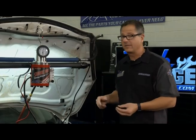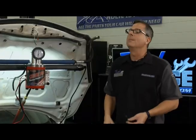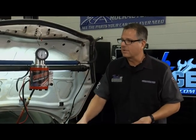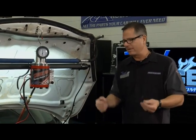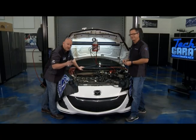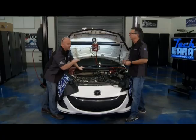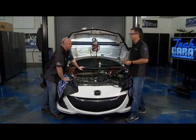That oxygen sensor is down there going, hey, we're lean — we're super lean. You know what the computer does? It compensates. Injectors go rich. So the driver doesn't even know it. He's driving down the road, everything's great. But gas mileage? Not good. I'll bet that was a symptom he didn't realize — the fuel economy was down because that ECU was desperate all along the way to keep it at 14.7 to 1.